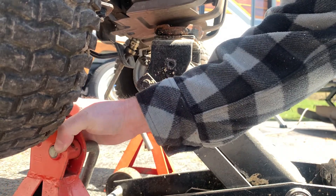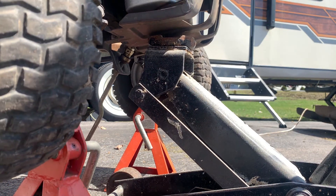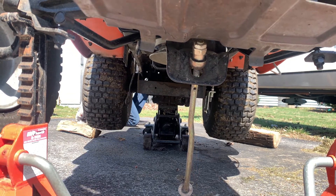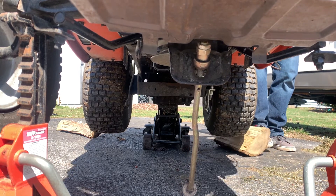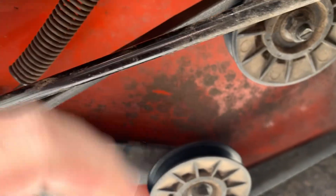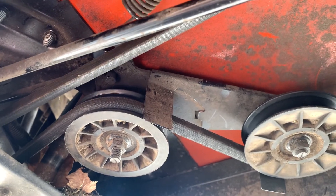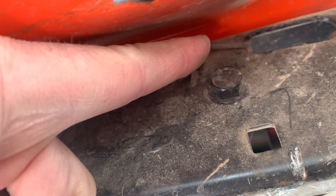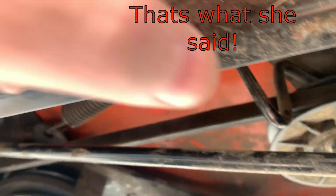I'm always well-prepared for the things I gotta do for YouTube. After further research, this spring is actually in the right spot. It's a brand new drive belt from when I bought it last year. The pulley bearings seem fine — I put a spin on them and they're not gravelly. Doesn't mean the channels aren't worn out, but I'm going to try moving this spring to get about another inch or so of tension.